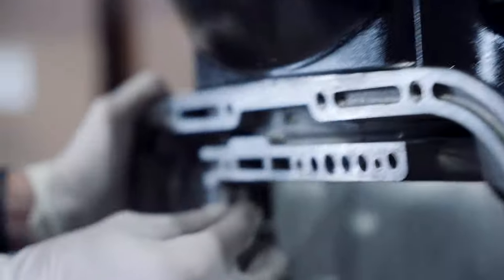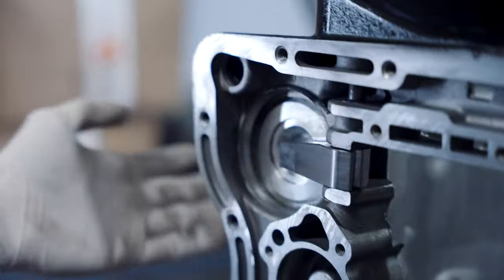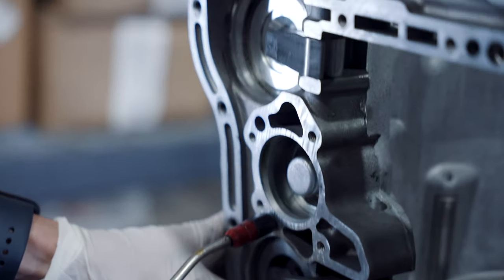Because it essentially pressures up, as you can see. I'll kind of explain this to you guys. The servo design is actually really cool. So this is how you air check it. Obviously, you always want to air check it. Reverse band right here, third gear band, whatever you want to call it. You're going to see this pressure up.